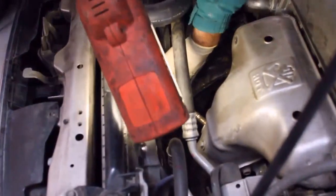This is a 1997 Honda Accord 4-cylinder, and a common problem with these cars is the front motor mount wears out. The vibration isolator. Engines vibrate, and the way they connect to the car needs to insulate the car from that vibration, or you'll feel it everywhere. And when the car shifts, the engine also has a torsion movement that the motor mount helps control.